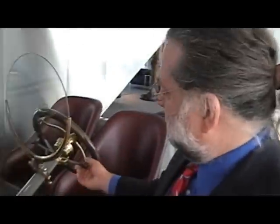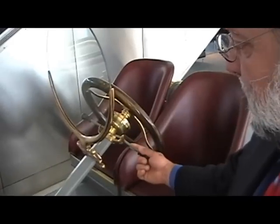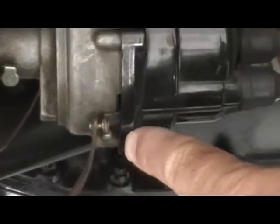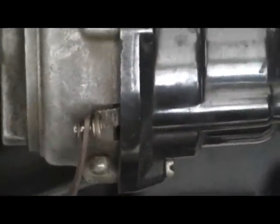The way these units had their timing adjusted was that they would be turned on their pedestal a certain amount, indicating how far in advance or how far behind top dead center we would fire the spark plug. With alcohol, we'd want to fire earlier. To adjust this for alcohol and gas, we go back to the cockpit and find right here on the column is our spark advance knob. I can adjust it back and forth, and as I turn this you'll see how we can change the timing — pulling it down or pushing it up changes the timing of the spark within the distributor. By adjusting these two things, we could go from alcohol — found on every farm in the United States — to gasoline found at Rockefeller stations in town.